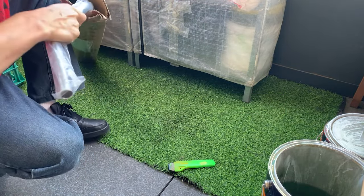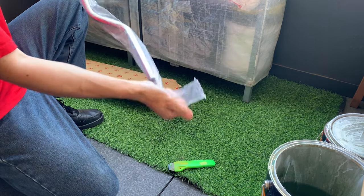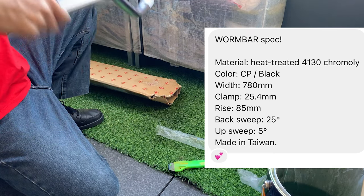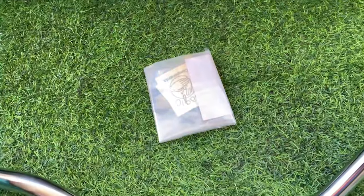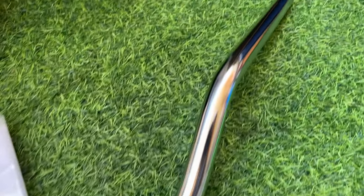You might have noticed on my sleeper mountain bike restoration that I bent the moto bars because they were aluminum, and I took the crossbar off. So these are the specs for the bars. They're steel, 780 width, 25.4 clamp and a pretty nice sweep to them, so I'm keen to try them out. If you ever look for 25.4 bars, it's hard to find bars in a wide width. Most of them are around 600, 660, and these are 780, so stoked to try these.